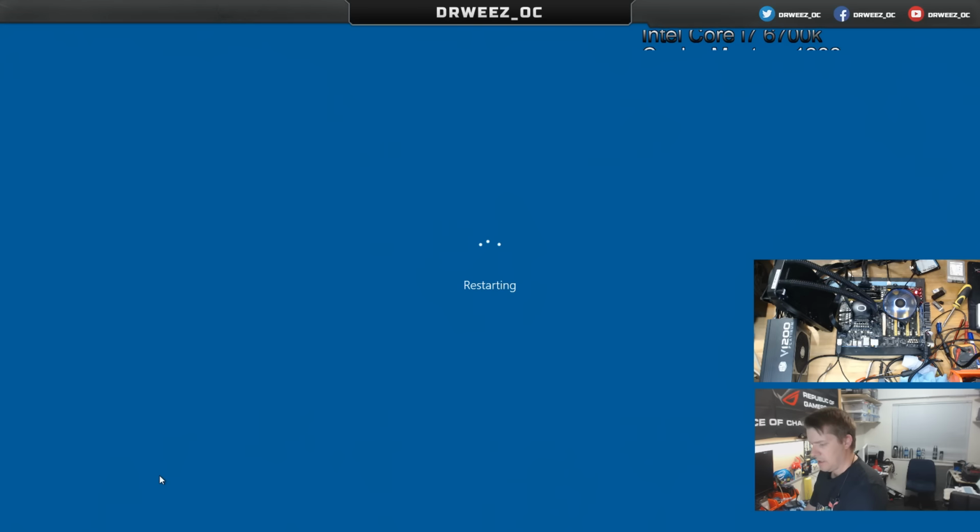Then change the voltages. We're going to take it to fixed mode, and we're going to make it 1.35, say for instance. Leave that at 1, and we'll leave everything else at standard.